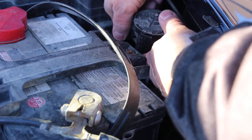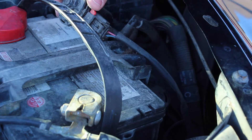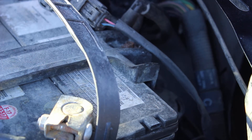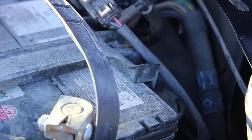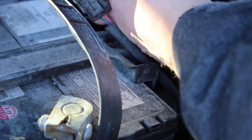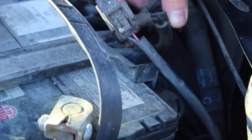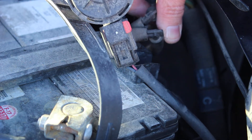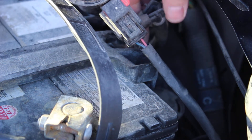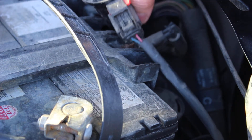Let me pull this off and roll it up a little bit sideways. Hopefully you can see that there's two hoses on the back side of it. There are two fittings on the bottom of the purge valve — hoses that come out of it, two plastic elbows, and then two hoses. One of these hoses comes from the intake manifold of the truck, so it's under vacuum.